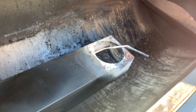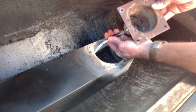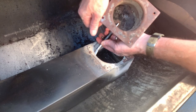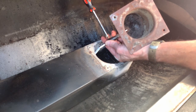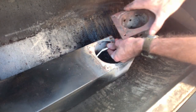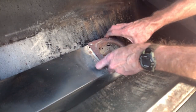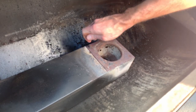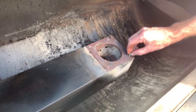Let's go up here and get this thing put back in the pot. All right, we got her done, pulled all the way through. Haven't done the underneath side yet — we'll show you that. Now let's get the burn pot back in here. About a quarter to half an inch — you can see it right there — a little bit more, there we go. Quarter to half inch is what Pit Boss says, so do what they say. Slide it down in there — there you go. Let's get these screws back in place. Don't cross-thread on me.